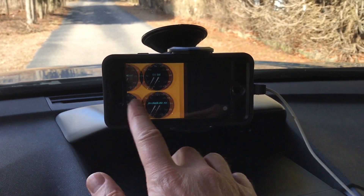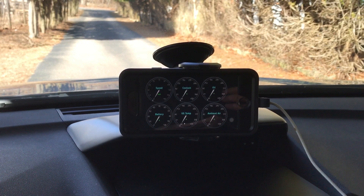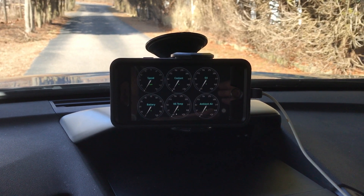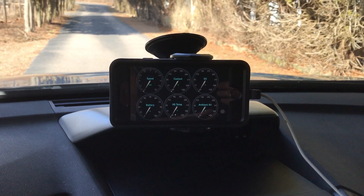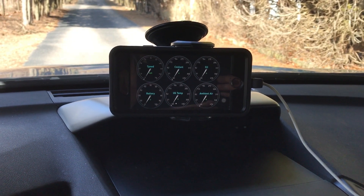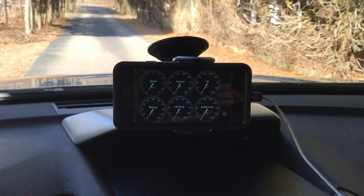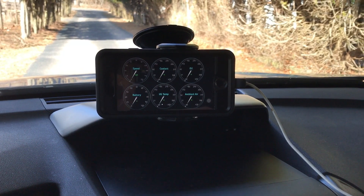If you just swipe across, there's my night setup — same gauges. You can see the ones I was primarily interested in on the top right: coolant and oil temperatures. I filled it up to make a full six-pack — speed, battery voltage, UG temp (the temperature of the module itself, which tends to run around 77-78 degrees), and ambient air temperature. You can set alarms for all gauges — minimums, maximums, temperatures, pressures. For UG temp I have it set for 100 degrees, and coolant I have set for 220 degrees. It seems to run consistently between 197 and 203.